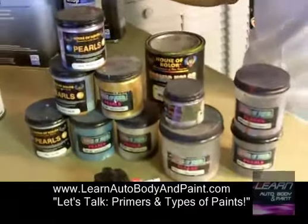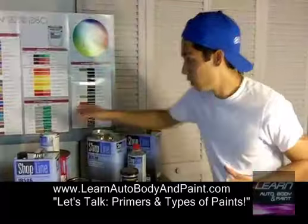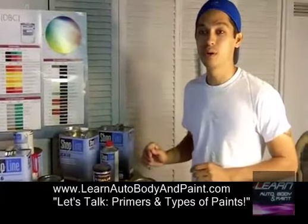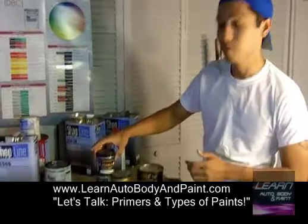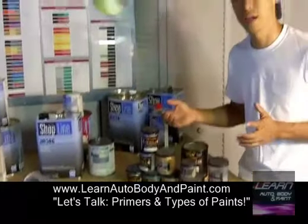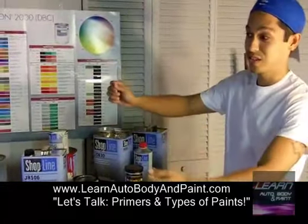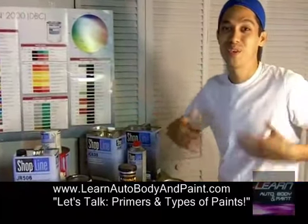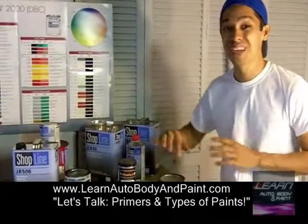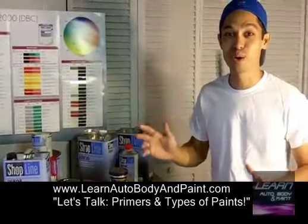What I started with when I first started was painting a motorcycle tank with a white base coat, then mixing in a little red pearl into the clear coat. Very little, because it really shows up, and the more coats you put on it, the darker it gets. I would do a little bit of red pearl, paint it, let it dry, go out in the sun and look at it — it was really beautiful. It's super cool when you start experimenting with different types of pearls and flakes. I really highly recommend you try pearls and flakes.